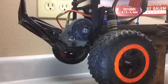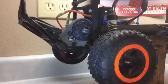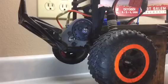Obviously this is not good, and when you actually run the car, right now I have my pinion taken off, but when you actually run the car, it is not running very fast, and it takes a lot of work. Your motor gets very hot. So the problem here actually is not in your motor, it's on the bushing.